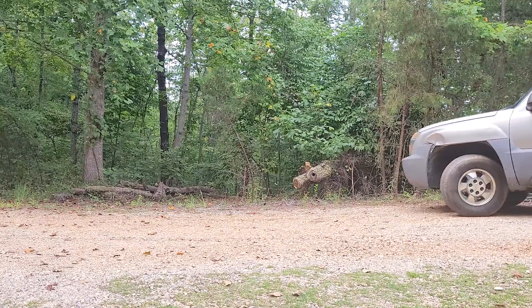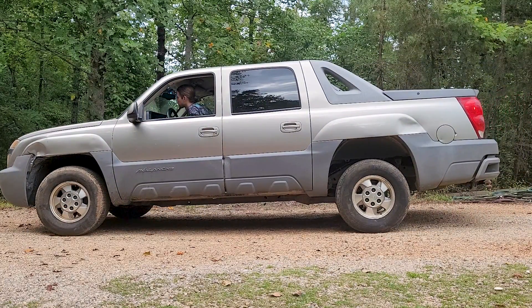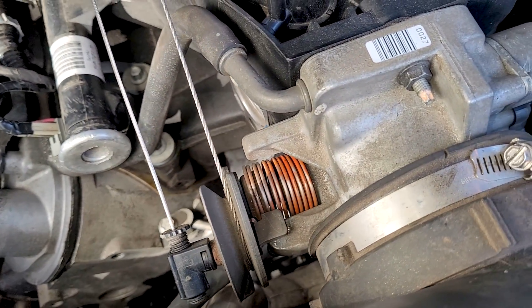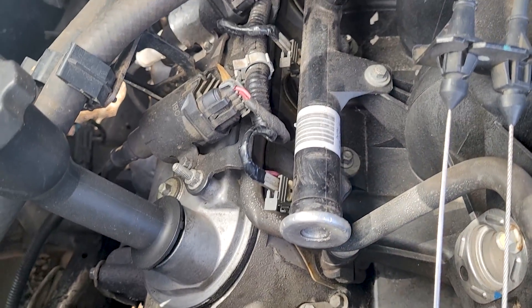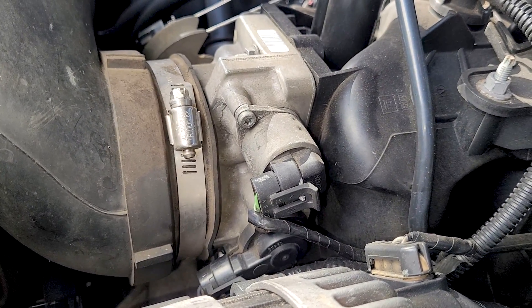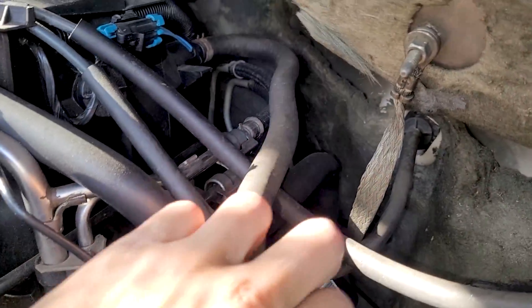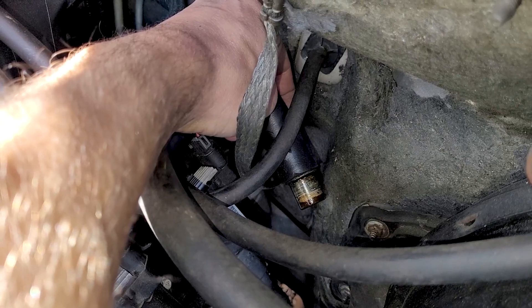Let's go ahead and take a look at the abandoned Chevrolet Avalanche — that thing has a 2002 5.3 Vortec V8 automatic, and we're going to see the differences. We've got pretty much the same thing over here. This is a drive-by cable right here — you can see the hard cables. It's not drive-by wire like the other engine because this is older. There's a vacuum line right there that goes down to the top of the valve cover. It's got some O-ring seals under the throttle body position sensor and the idle air control valve right here, and under those there's some O-rings. This has got the removable PCV valve down in here with a grommet around the valve cover — it can leak.